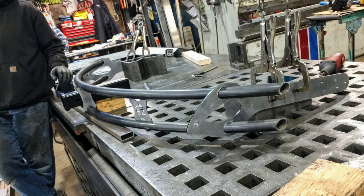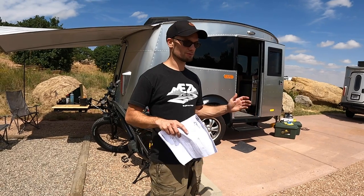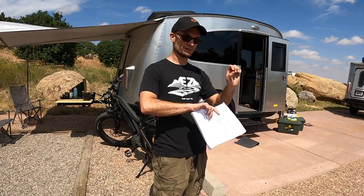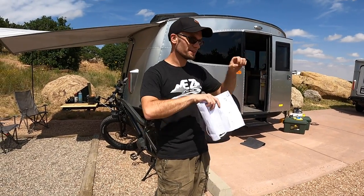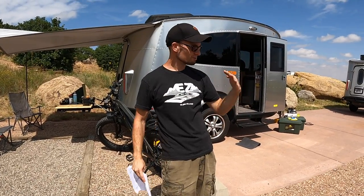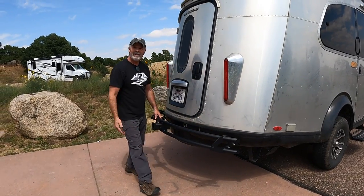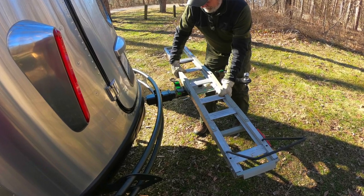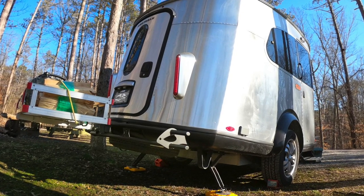Then we transferred into metal and welded a basic shape, and we discovered when we put it on that it looks like it's falling. So we ended up rotating the tubes in the openings — it's a very complex angle because your frame actually goes up. We wanted to follow the lines so it looks like it belongs from the factory. Even though the bumper has a certain angle, the hitch has another three degrees to keep departure angle and keep you high in the back.